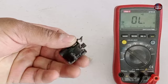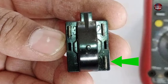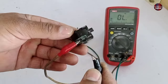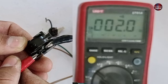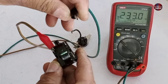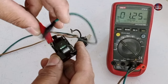Now I will test the PTC relay. It has three terminals on the front — terminals 1, 2, and 3 are numbered on the PTC relay. I will test it on continuity in the ohms mode through the multimeter. The 1 and 2 terminal points are in series, so I should get a continuity beep here. When I check both these points with the third terminal, I should get some ohm value on the multimeter. Checking between terminals 1 and 2, the multimeter is showing continuity — so terminals 1 and 2 are okay. Now testing with the third terminal in ohmmeter mode, we are getting almost 35 ohms reading of the PTC relay. This means the PTC relay is absolutely fine. Checking the next terminal combination should also show the same reading — the probes were not attached tightly, which is why it wasn't showing correctly, but the PTC relay is fine.